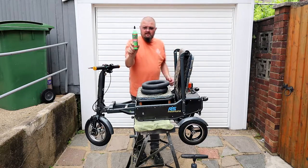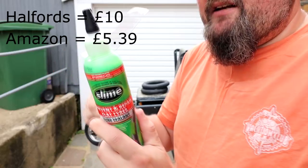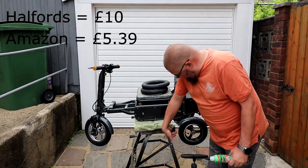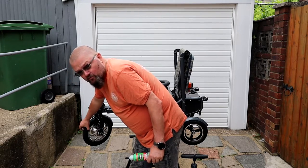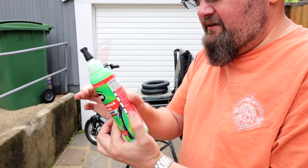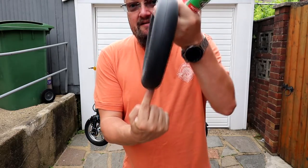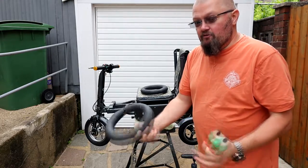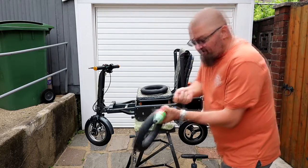Now, this is slime — it's actually called Slime. I can't remember how much this is, I will put it on the screen. Tube sealant. What this does is just protect your wheels. If you go over something, it has to be in the tread path — up the top, really, not on the sides. The walls are not protected. So if you go over, say, a drawing pin, as it's going around — this doesn't solidify, this is just liquid that is constantly spinning in the tyre — if you go over a pin like that, the pin falls out, and because the slime's in there it will seal it straight away. You might have to pump it up a little bit because some of the air might get out, but it's always handy to have. I normally keep one of the mini hand pumps in the back.